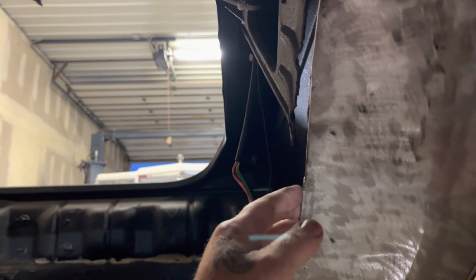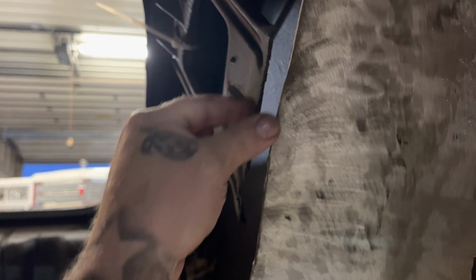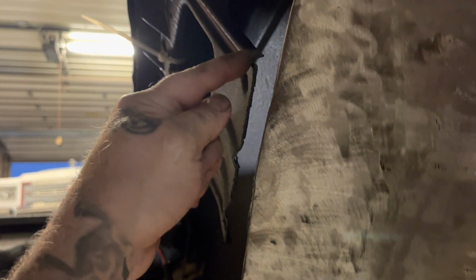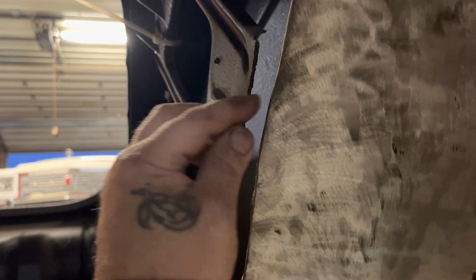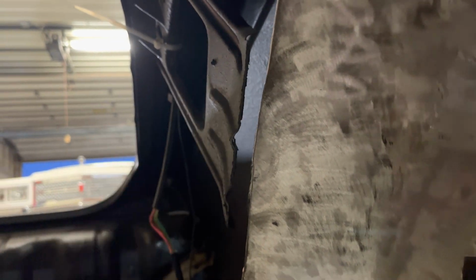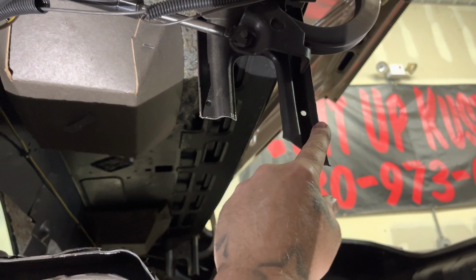When all this is done, then when I put back in here, I'll put a piece of 1/8 inch flat stock so it'll be strong enough. But you gotta clean off all this debris on here. You know, clean this ridge up a little bit. And then when the tub's in here, the brace goes right here, boom, boom, that'll be tied back together. This has got to get trimmed down some more, boom. But yes, all this debris, nasty, nasty, nasty.